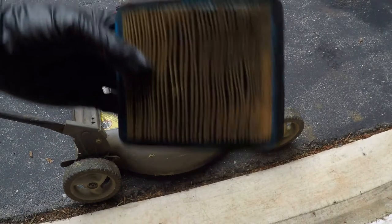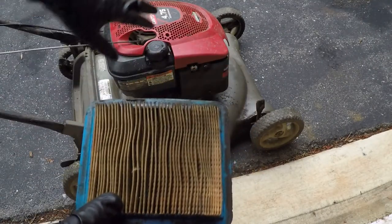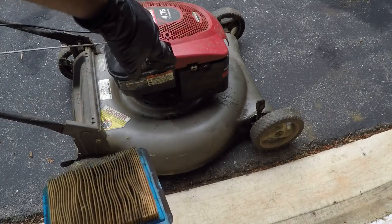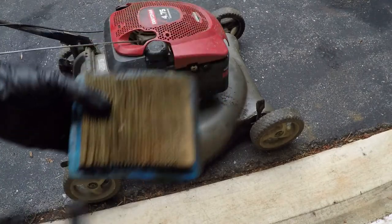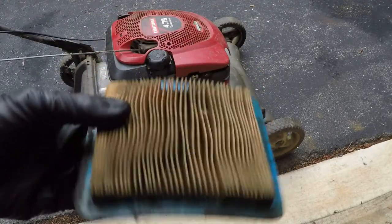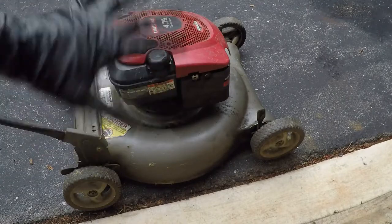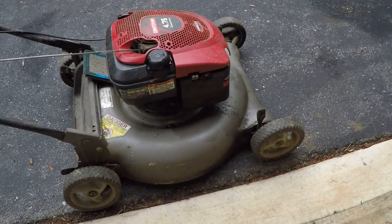Good, I'm satisfied. Incidentally, this happens often when you tilt the lawnmower the wrong way to wash it or to get access to the bottom. You always want to tilt the lawnmower so that the air filter is up, or the carburetor side is up. Never tilt it so that side is down, because all the gasoline from the carburetor is going to run into the air filter, and you may even get oil from the breather tube coming in. So yeah, always tilt it air-filter-side up. Thanks for joining me — a gas and oil soaked air filter was the whole cause of our no-start condition, in addition to a bunch of missing hardware. Keep your filters clean and I'll see you next time.